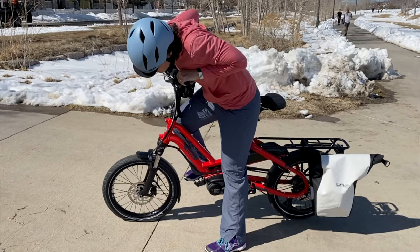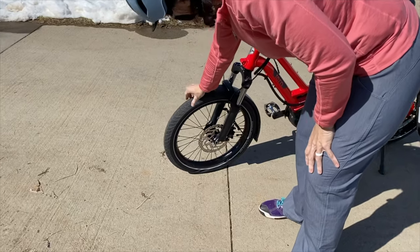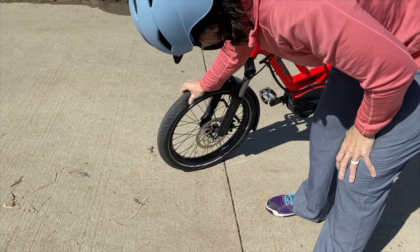There are a few things to know about air pressure. If your tires are too soft because you haven't been checking the air, they can be dangerous because these electric and cargo bikes are heavier. So when you're going through turns, it might feel a little squirrely if your tires don't have the right pressure to keep the volume and sidewalls where they should be. If they're too hard, your bike is going to be a harsher ride than it needs to be. And last but not least, preventing flats by having the proper inflation — if you're not inflating often enough, you may risk getting punctures or a pinch flat, where your tube gets pinched between the ground and your bike and causes a flat tire.